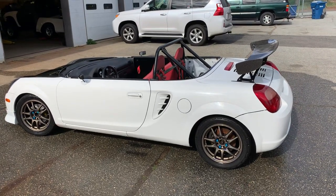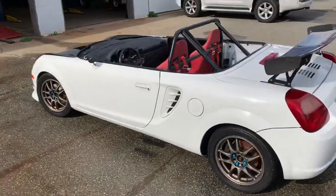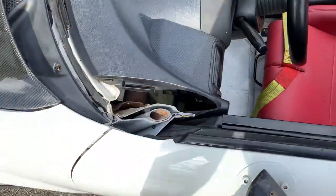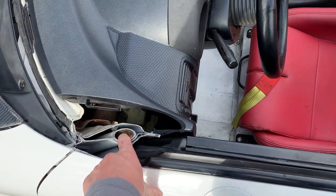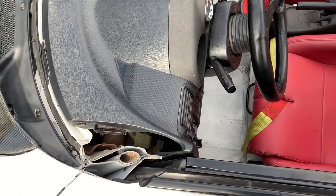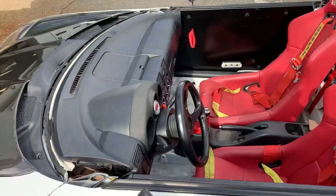We're going to set it up so we can pin the windshield back on so we can go get stickers and I'm going to try and drive this car on the street periodically. The factory windshield frame has a roll bar inside it — you can see this tube here. What we're going to do is sleeve that and then pin it through the threaded fastener so it'll be bolted in. The sleeve will be bolted in so it can't leave, and then similarly pinned into the windshield frame. The glass will be bonded on three sides — top and both sides — so we can slide it back down and pin it in place.